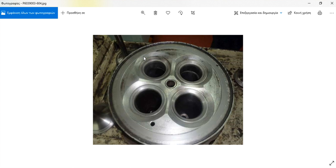Here we have our cylinder head ready and cleaned. What we also found — really impressive — was one inlet valve placed in the position of an exhaust valve. Also, I want to tell you: when you apply numbers to your valve seats or valves — say number one, two, three — be careful, because sometimes the numbers are not visible clearly. I have observed people putting different numbers, for example writing four where it should be three. This is very bad practice. Apply the numbers carefully.